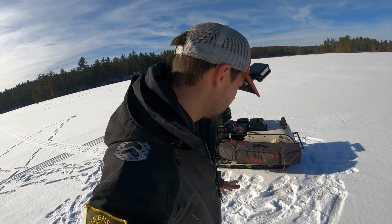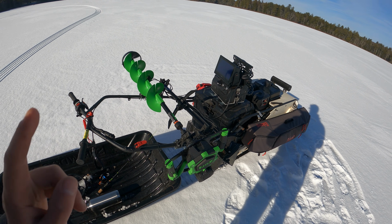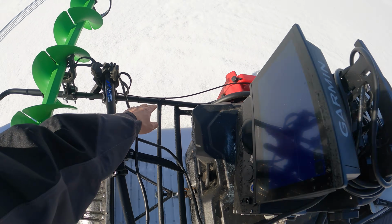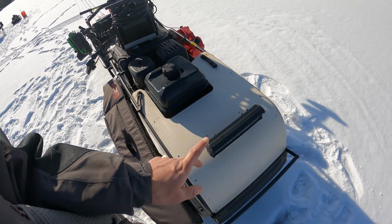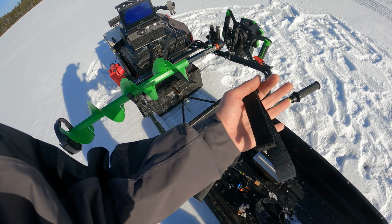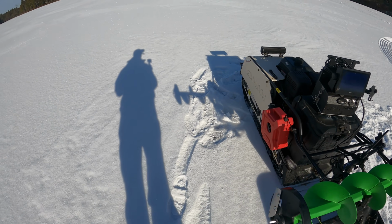Now let's go over the dislikes. Now there's quite a few dislikes. This thing has tried to kill me a couple of times. One, because this is just like a normal bicycle throttle cable. If you pinch it over here, it gets stuck on full throttle when you are trying to start it. Now they always say run your kill switch, which is here, and they also say to run your leash. I had mine in reverse, and it says never start it in reverse because it'll run you straight over, which is what happened to me, which is my fault.